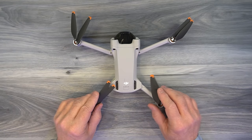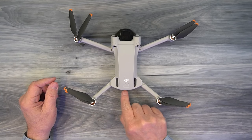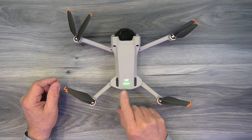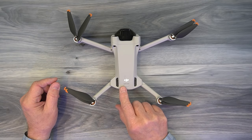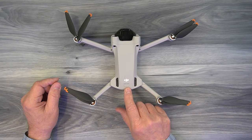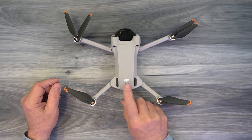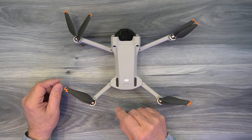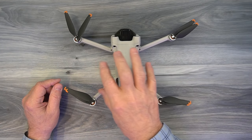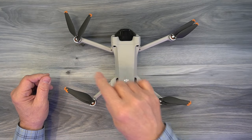On the top of the drone, there's a power button on the back. The battery is internal, so you check its charge level through this button. Tap it and each LED represents 25% — if one is flashing, it's less than 25%. Three lit plus one flashing means 75–100%. To turn the drone on, tap and hold the button. It'll run a power-on self-test, moving the gimbal to check freedom of motion, checking electronics, and looking for the controller — so make sure the gimbal cover is off first.